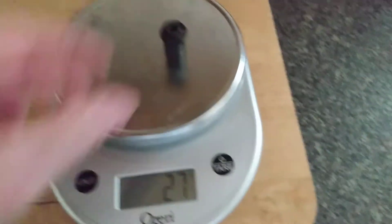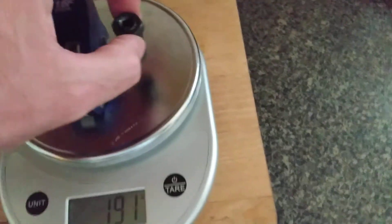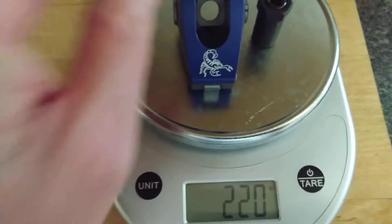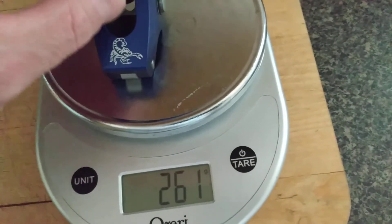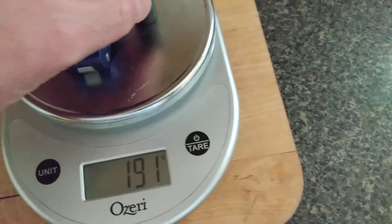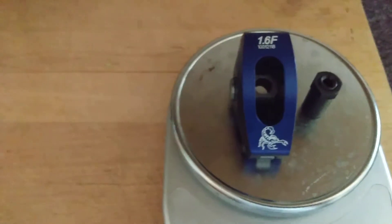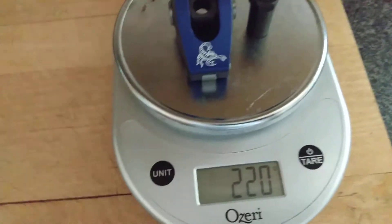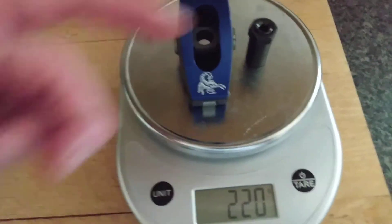19 grams lighter for the aluminum. I mocked these up real quick and just turned the engine over, and it definitely looked like the poly lock was not touching back there. It actually looked like there was plenty of room at full lift. I'll have to check it — making sure the lifters aren't plunged all the way down if they pump up a little. But with the hand starter it looked like there was plenty of clearance back there.